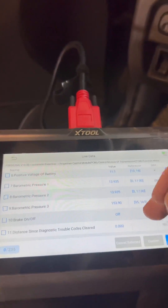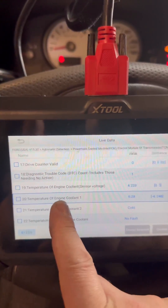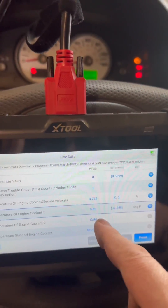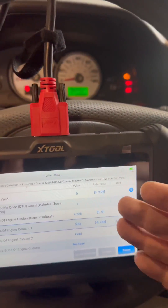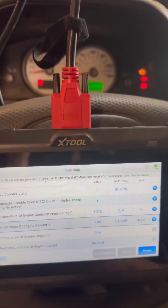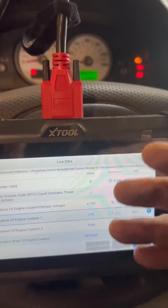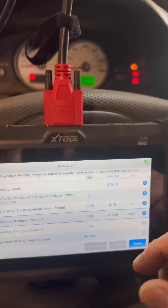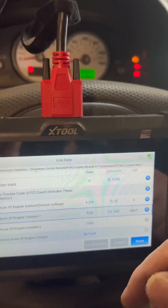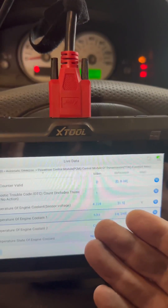We go through live data and look for anything that is off — we can hang the scanner right here from the steering wheel. Believe it or not, a coolant temperature sensor being way off will make the car not start. That's why it starts when the engine is cold: it adjusts the air-fuel ratio on startup. Then when you shut it off, your engine temperature is close to 200 degrees but the sensor is still reading around zero degrees. That'll cause a no-start until the vehicle cools off again — that's why the tow truck driver said it started right up when he got there; it had time to cool off.